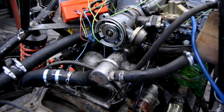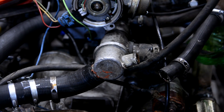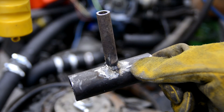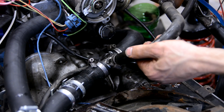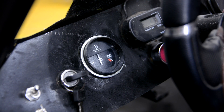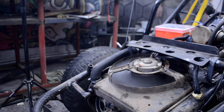I noticed the radiator was cold and the branch pipe after the thermostat was too. I decided not to replace the thermostat and simply removed it from the system, replacing it with a coupling fitted with a nipple for the expansion tank. I installed a temperature gauge from another car along with its thermal fan-switching sensor. When the temperature reached approximately 90 degrees Celsius, the fan switched on and cooled the system.